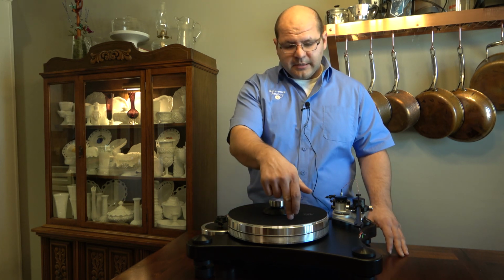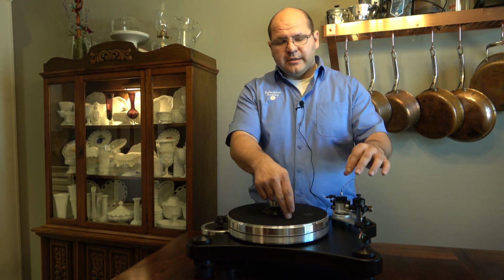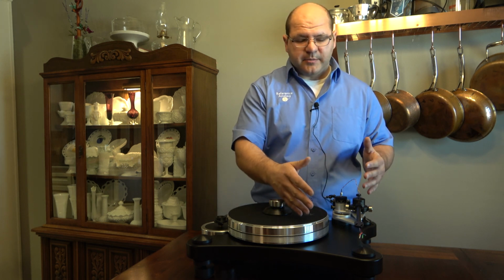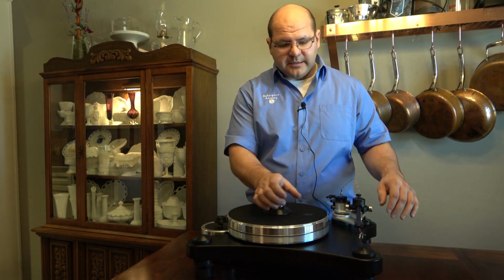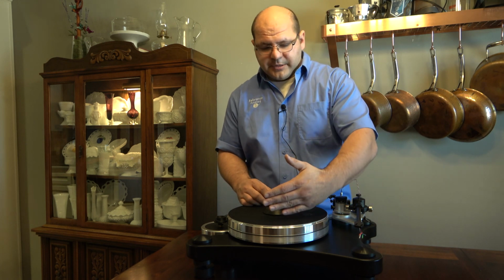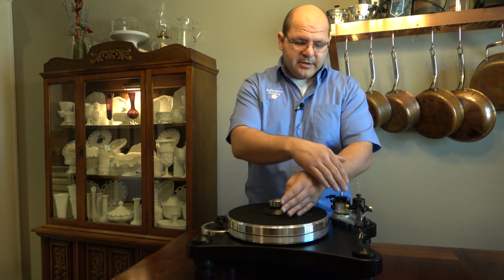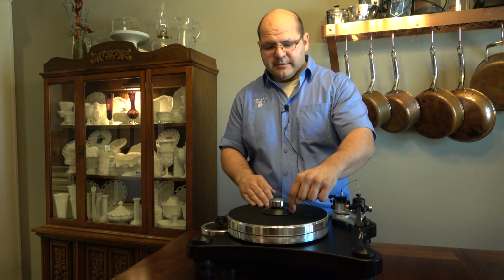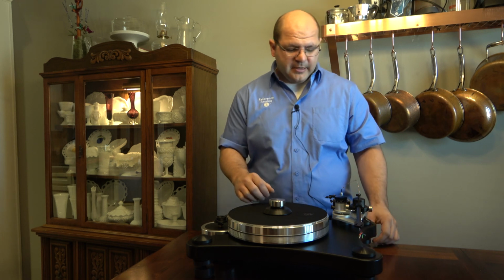So, your overhang is essentially the point on the setup jig that you're trying to get your stylus to fall exactly on that mark. And that's kind of your overhang, so how far your pivot to spindle distance helps dictate your overhang. So anyway, that's how far out your stylus is. And then you want to set your angle with your protractor. Your angle for that is actually twisting the cartridge like this so that it is straight and overhang's correct. And then your tilt is going to be your azimuth, so it's entering the groove correctly. And then your VTA is that stylus adjustment doing that. And this is something you're going to show everybody when you're setting this up. We'll do a setup video and we'll go back over everything. But that's essentially the basics.